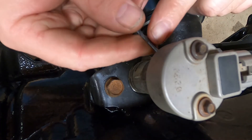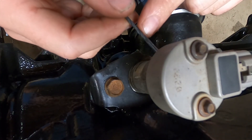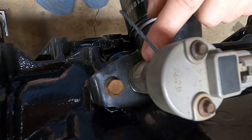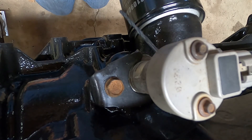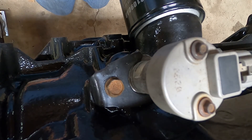The last thing you must remember to do is remove this drill bit. If you don't, the aperture inside will be damaged when you crank the engine, and you would then need to replace your oil pump drive — you'd have to buy a whole new unit. So just remember to take out your drill bit.